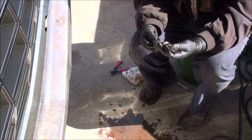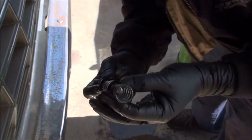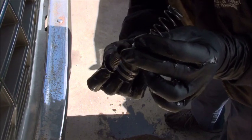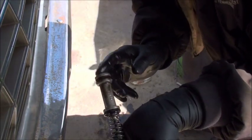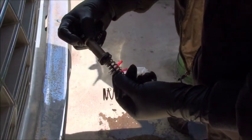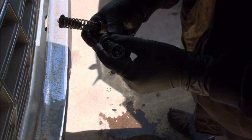This is what's inside of it. By looking at it, the seals don't look so hot — they're not soft either. And like I said, this ain't that old; I don't think they put new seals in this. Here's what's stacked up in there: you've got a spring from the back, a cup seal, an O-ring, another cup seal, another spring, another cup seal, another cup seal. That is inserted into the master cylinder. The seals have markings on them but I can't read them. This is poor — this is hard as a brick, almost to the point of plastic. They're just crunchy, they're just not right.